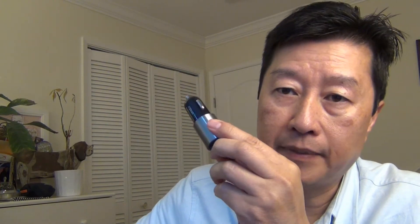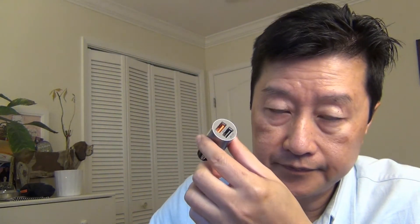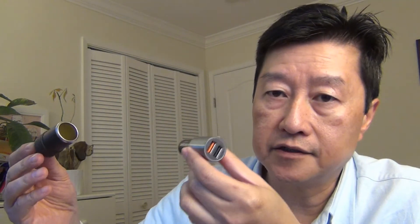All you need to do is buy one of those car USB chargers. Make sure it can handle 24V — some car batteries are 24V and the cigarette lighter socket is 24V. Since this Ryobi is 18V, you don't want to blow up the device, so it has to be rated for 24V. When you set it up, it's a very simple device to charge your battery.